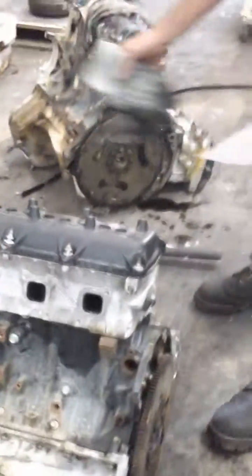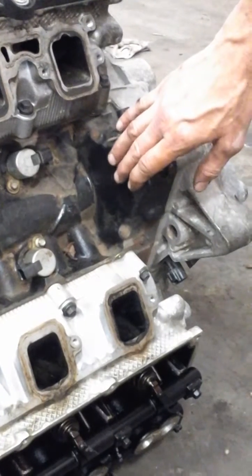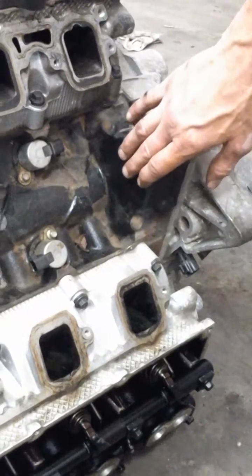We're going over Hemis here. First thing to look at: you've got an early Hemi or you've got a late Hemi. See the solenoid up here going through? If it's got this — nothing here, no boss, no hole — you're looking at a DDF3, DDK1, DDH8, or DDH9. Those are the early Hemis.